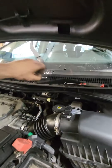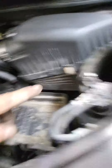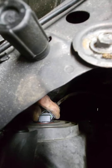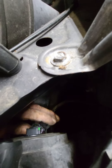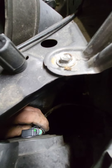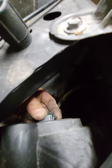10 millimeters for your J-hooks — if you still have them on there, they're probably rusted just like this. Typically they will break. Two 10 millimeters on your battery cables. You're going to reach under here and turn it counterclockwise to release it, then clockwise to install it. There's one little clip on the side here — just push down and slide the connector off. Make sure when you go to put it in that you don't bend the pins, and listen for it to click in.